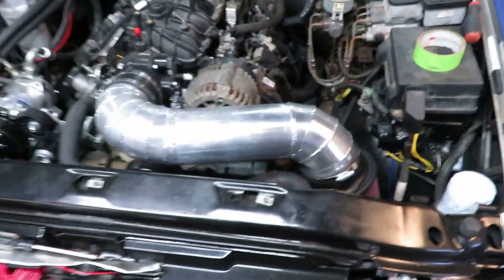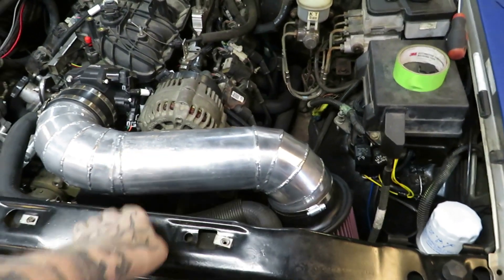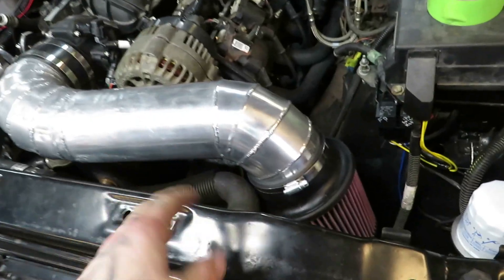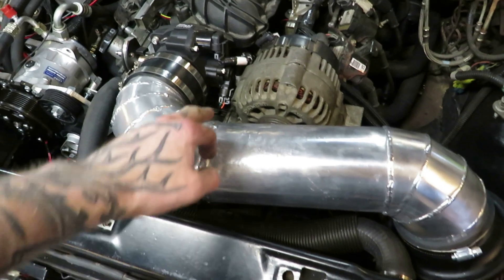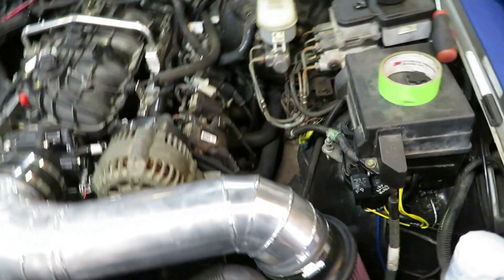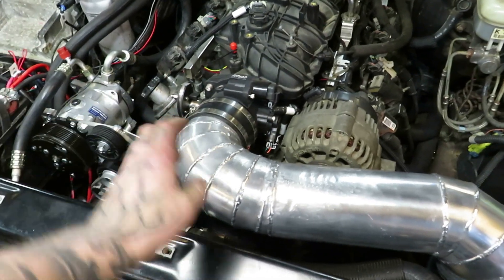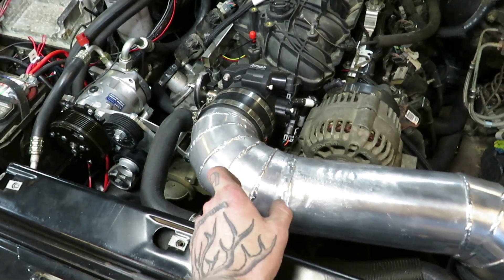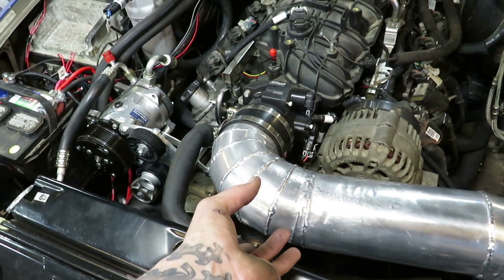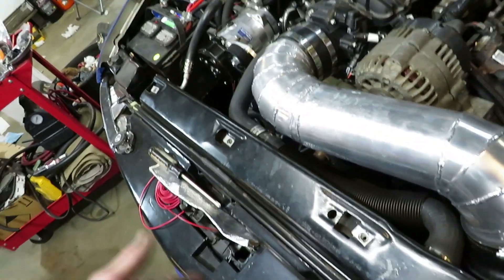Got the intake on, polished up, so it looks halfway decent. Had to cut the other brackets off, then took some sandpaper and a Scotch-Brite wheel over it. The welds don't look bad on this side. That spot is where that one messed up piece came out the end. I think I cut both my straight six-inch straight pieces of Spectra that I was using for pie cuts, and got down to the very end trying to cut it in the bandsaw — it was squeezing it into an oblong shape, cut it funny with weird gaps.